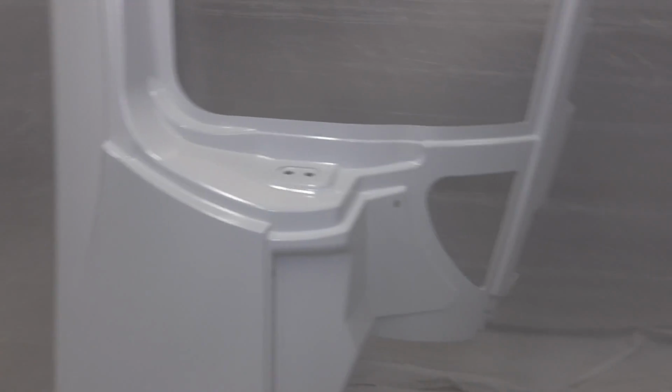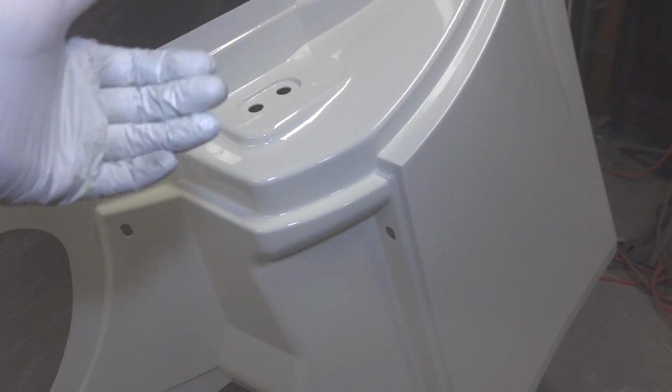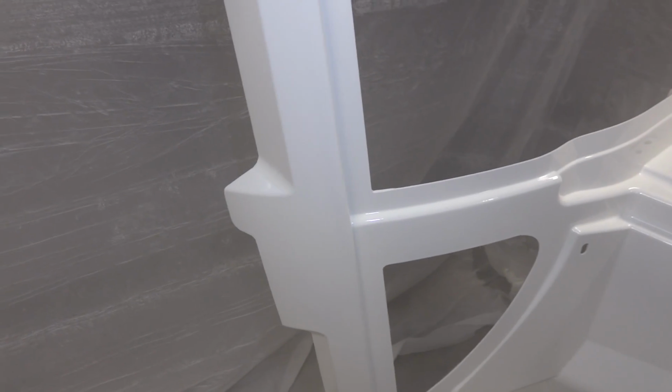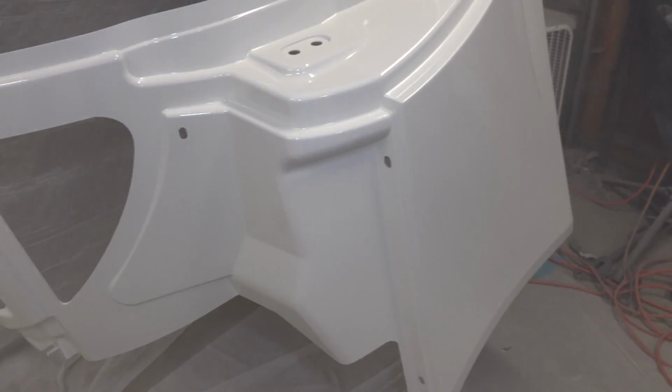I don't know, but I'll know more tomorrow when I can see, because this is a single stage paint, right? So the gloss needs to come out of this and sit in there and be all glossy. And I'll know more tomorrow if it can really do that with that thin of a coat that the small gun puts on there, and how the coverage went, because right now it's all wet and it all looks great.